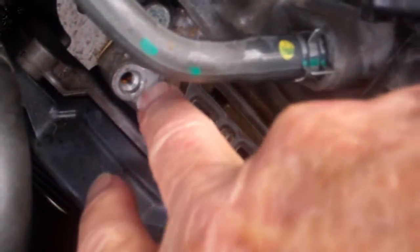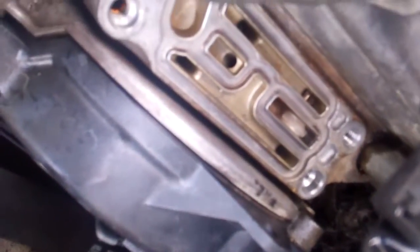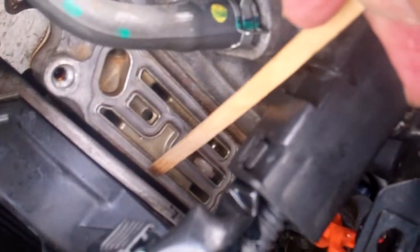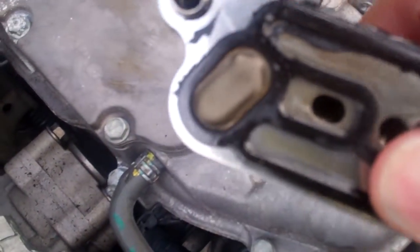So the answer to my question — somebody said just put gasket sealer on it. Well, that's not really a surface. If you look at how thin that outside edge is, it's only made for the o-ring to seal, not the metal plate flat to flat. That outside edge right here is so thin there's nothing that seals that. This o-ring gasket sits in these grooves, and then this metal plate right here seals against the o-ring.